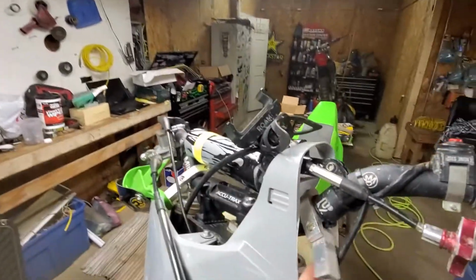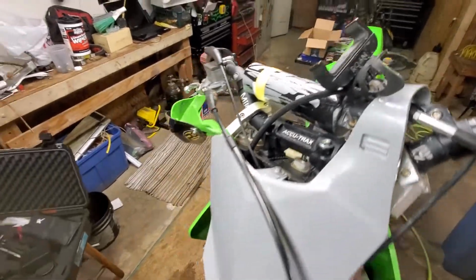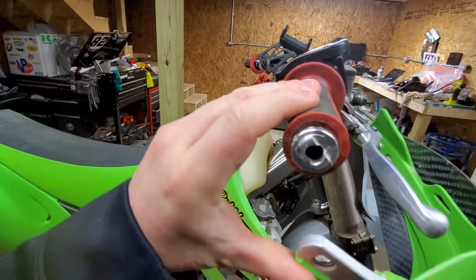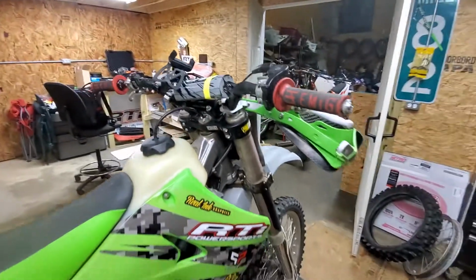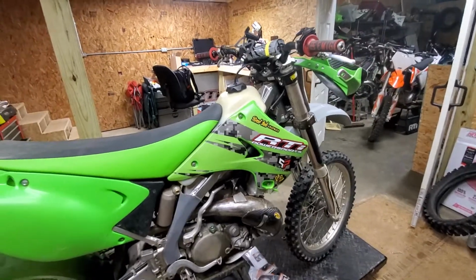I've got some bark buster bolts that are like loose, but they're stripped. And then this side fell out or ripped out at some point. So what I'm going to do is take these out and basically thread my bar ends just to make it a simpler, more durable setup. So I'm going to do that.